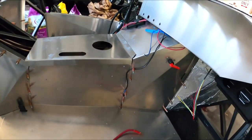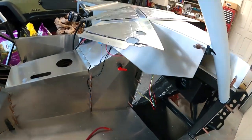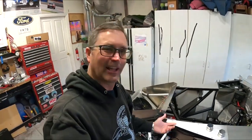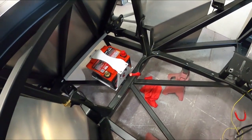I put our battery disconnect switch right here, but this is not going to actually disconnect from the starter — it's basically just going to disconnect from all the power inside the car. I like the starter battery cable going directly to the starter; that's your highest amp draw thing in the car by far. A good starter can draw a couple hundred amps at full tilt when you're really trying to fire it up. That's going to go directly to the starter, which goes directly to ground. Most disconnects are only rated for 150–250 amps, and if you really get a cold motor you could be pushing that.